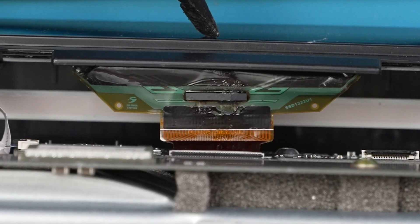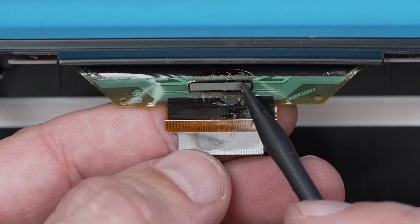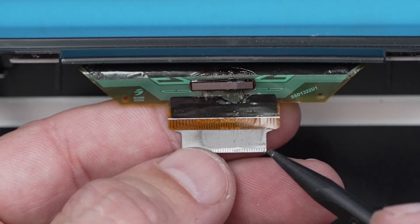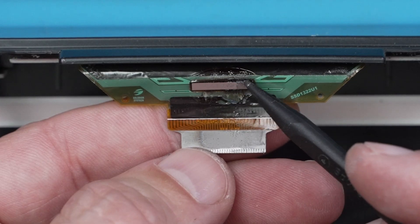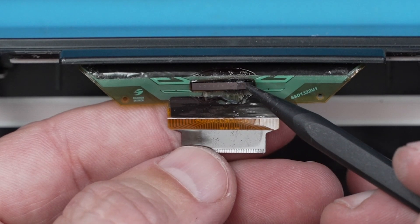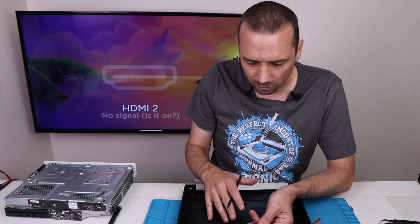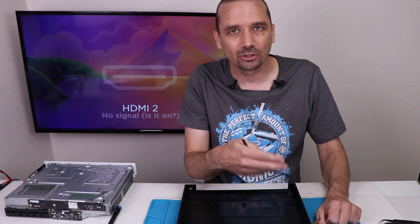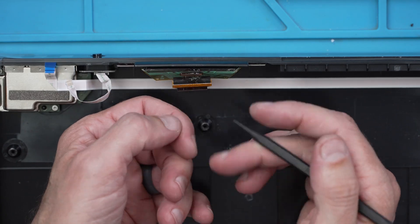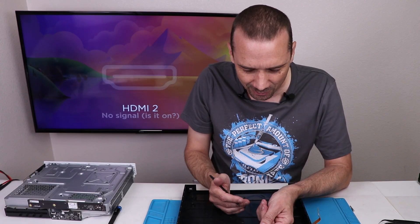That means most likely this screen is never going to work again. I think actually this was plugged in just fine — this chip is actually cracked right here. So what probably happened is I plugged it in and put power to it without noticing that the chip was cracked. And then because it's cracked, there's some sort of short circuit inside the chip and it just totally melted. I think this console probably went through a drop, judging by all the little broken pieces inside. That's what caused all of the magic smoke to be released.